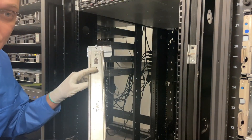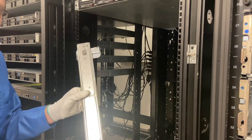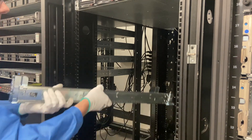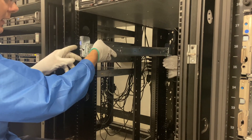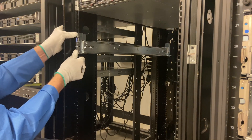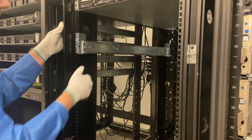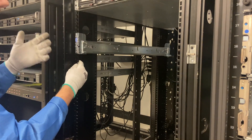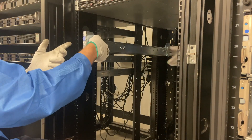We're going to start with the left rail first. You'll notice that it says 'left' on it, and here are the inners that slide plus the outers — the complete part of the rail kit for the left side. One of our techs is in the back. Angel, we're going to line this up on rows 16 and 17. You heard it click in. Now I'm going to line mine up perfectly at 16 and 17 — you'll hear it click when I push it in. It's fully in, and when I shake it, it's not coming loose. If you do need to remove it, this blue clip right here — when you pull this out — you'll be able to take the rail off.